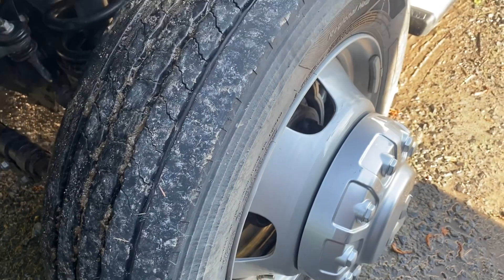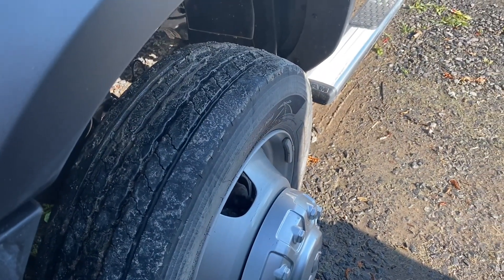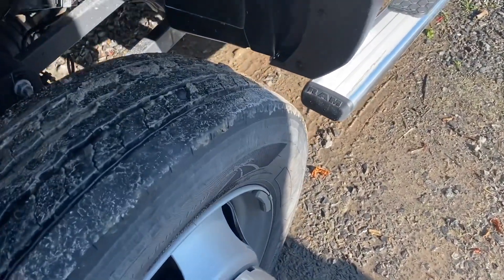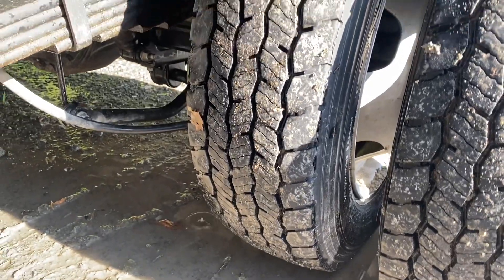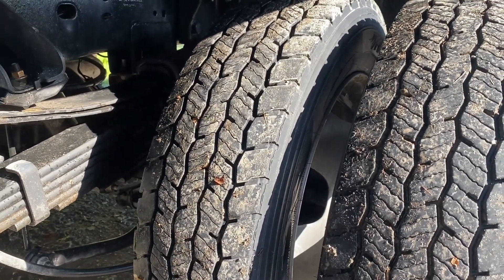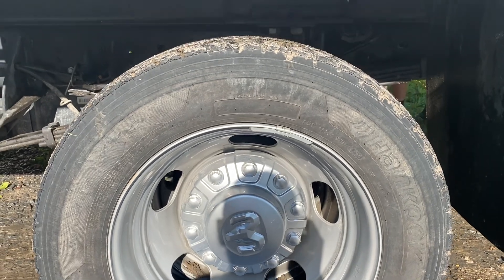One thing I noticed is that these factory steer tires start to go smooth on the outsides pretty fast. That's going to happen on any small truck in the waste industry with all the stopping, turning, and backing. We're sitting at about 8,000 miles on them now — we'll let you know what they cost when we replace them. We might switch to a more aggressive tire in winter for safer driving on snowy roads. It just so happens we caught a piece of wire in one tire today — it's not completely flat yet but we're bringing it in. Luckily we have spare 225/70 19.5 tires on hand from our other 5500.